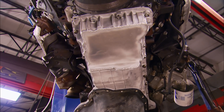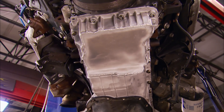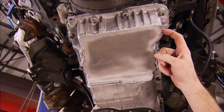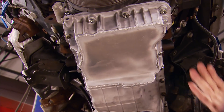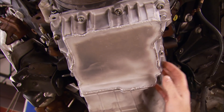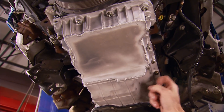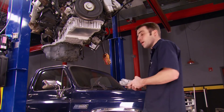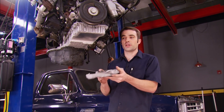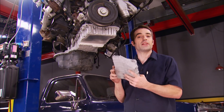To seal up the pan, I used a piece of eighth-inch aluminum plate that I bent and trimmed to fit. Welding it up wasn't that much fun — I kept fighting impurities in the cast aluminum that kept floating to the surface. But I got it done and it turned out pretty good. Before I installed it, I went ahead and leak tested it and checked the pan rails for straightness. Both of those things checked out, so I sealed things up and installed the upper and lower pan. Some of you are wondering if we've affected engine oil capacity by removing a small section from the front of the pan — and we did, but probably less than a quart.